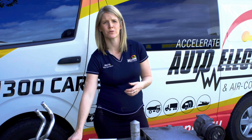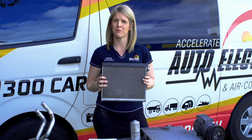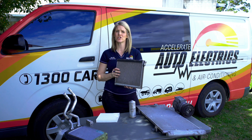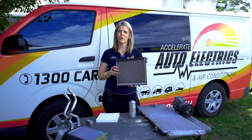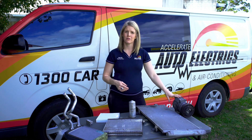As cold, low pressure refrigerant is passed through into the evaporator, it vaporises and absorbs heat from the air in the passenger compartment. The blower fan inside the passenger compartment pushes air over the outside of the evaporator so cold air is circulated inside the car. And now we're basically back to where we started with the compressor.